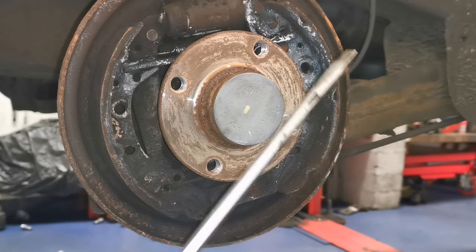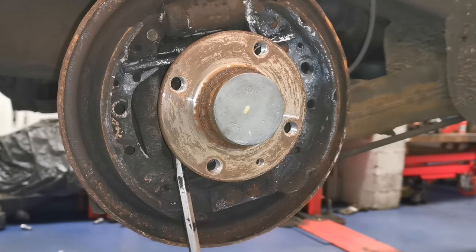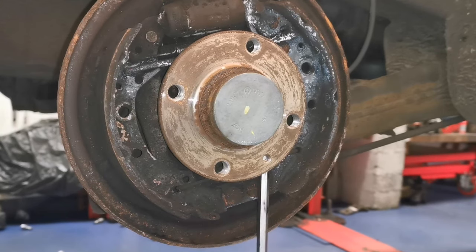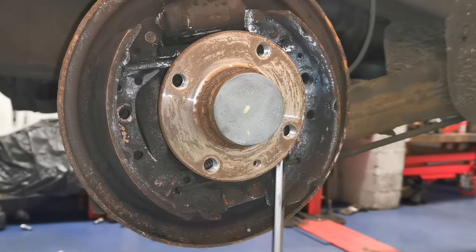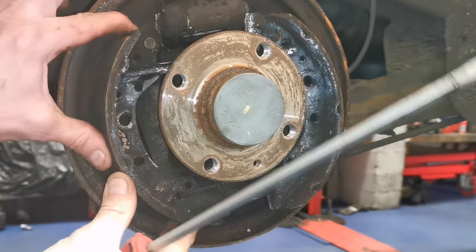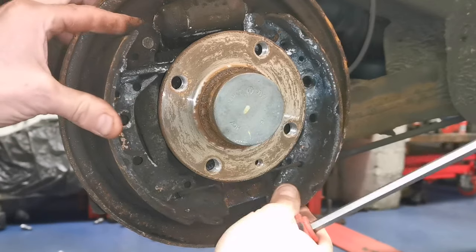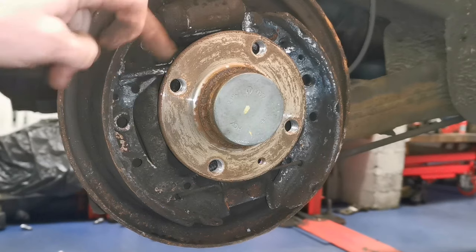What we're going to do now is release this bottom spring. If you have a screwdriver with flats on it, it's a wee bit handier - pop that up behind the hub and tease that out like that. Do the same on the other side. That spring is a lot looser now. What will happen now is the whole cartridge will rest on the hub - you can see it's dropped down and it's now sitting on the back of the hub.